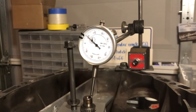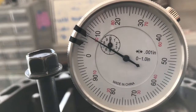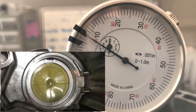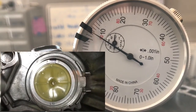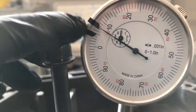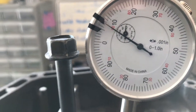I just swapped in the 1.53mm shim and landed just shy of seven thousandths — not within the specified range. So I'm going to switch it over to the 1.56mm shim and see where I fall. I'm hoping to land within the six thousandths range, but we'll see.